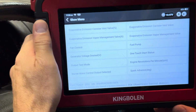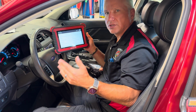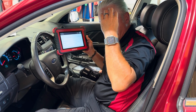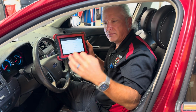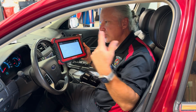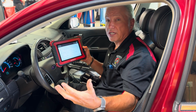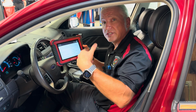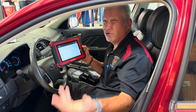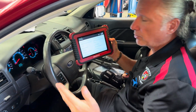Just be aware, when you're using any aftermarket scan tool and you're doing bidirectional controls, always have that little grain of thought in your head, a little tiny speck back there that goes, did that actually do it? I don't want to see you guys get caught where you hit a button and it said it activated a fuel injector and you didn't get a response from the fuel injector and you're like, okay, that's a bad computer or something. This is why I say always have multiple tools, because you can hook up another tool to it and see if it does it. That way you can be 100% sure that it's not the tool. And make sure you're using tools with two different types of software in them. That's the other problem. So that's just always with my bidirectional controls.